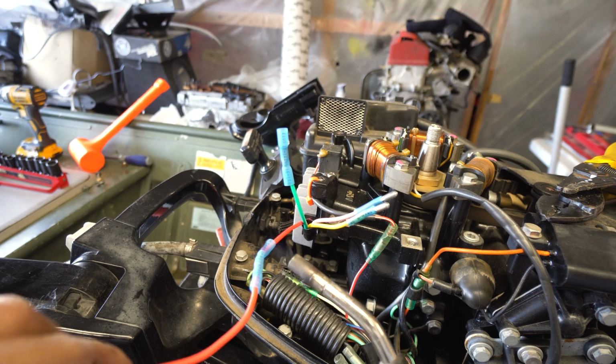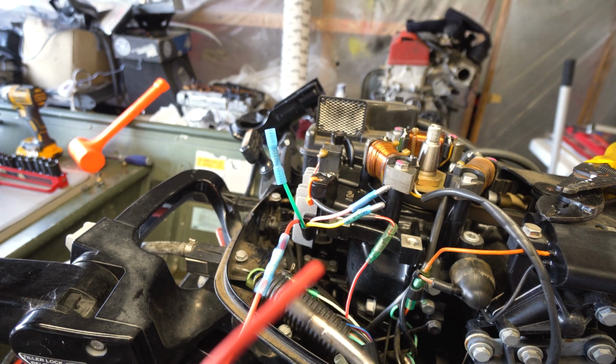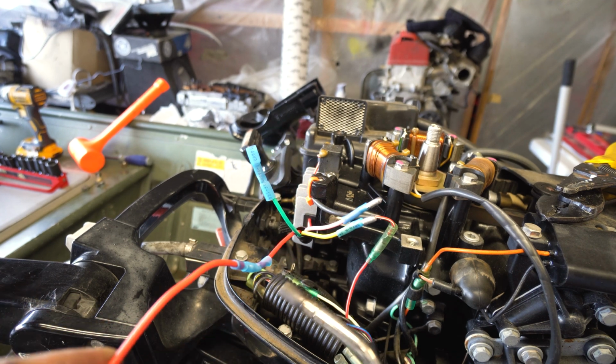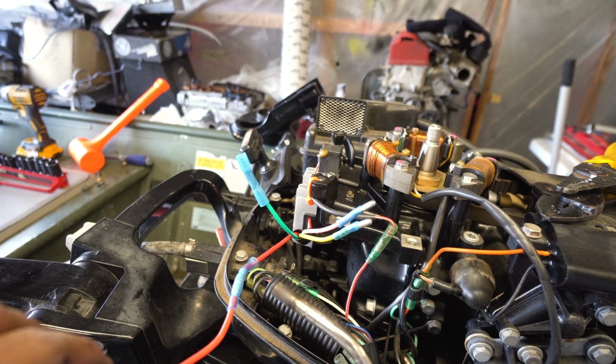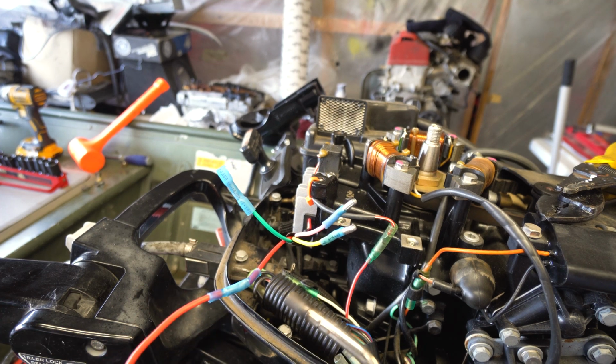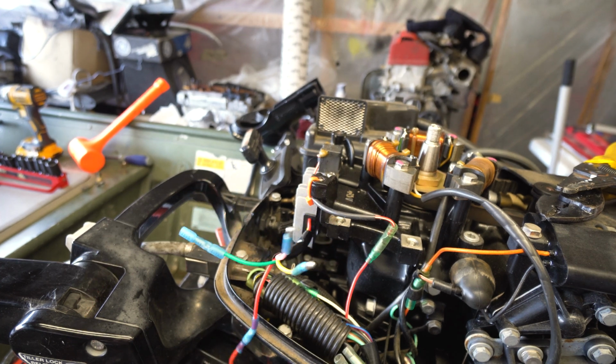It's not watertight, it's supposed to be, but when you crimp it, it kind of breaks the seal. So it's not truly watertight. If you really want it watertight, you can go ahead and apply some liquid tape on top of this, then it'll definitely be watertight. Unless you get the special tool. If you get the special tool, it might be watertight, but I don't have the special tool. I just have the regular tool. So every time you crimp it, it doesn't stay.